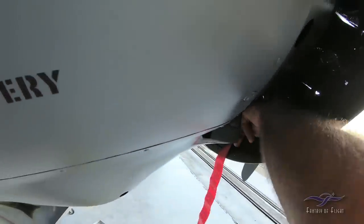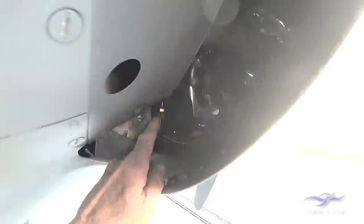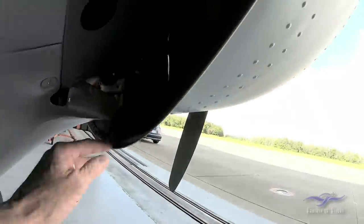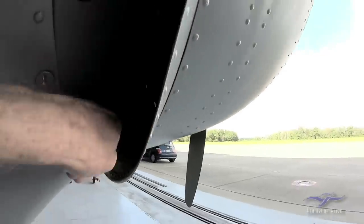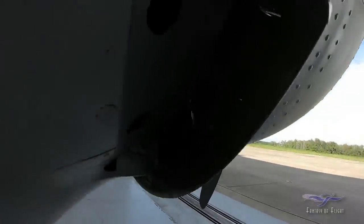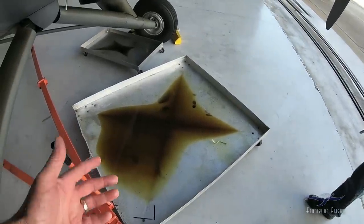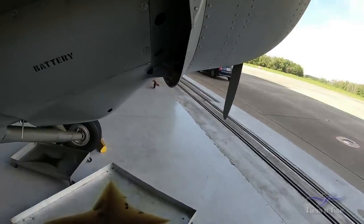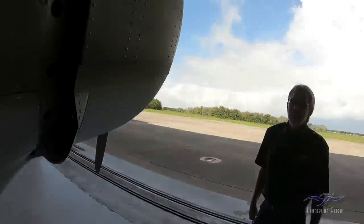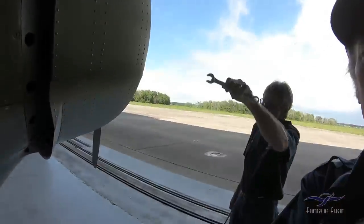This little thing comes off here, and if you look up there, there's a little deal right there that actually goes up into the intake pipe — two of them. If we undo it like that, it drops down and basically closes that off. So what we've done is all this oil, since we haven't flown it in a while, has been draining — a lot through the cylinders and also into the intake tube. It goes through the cylinders and back into the intake tube.